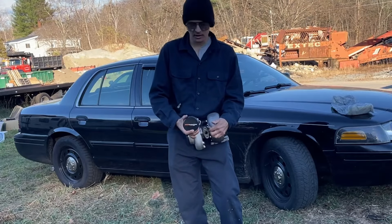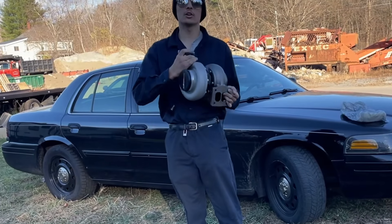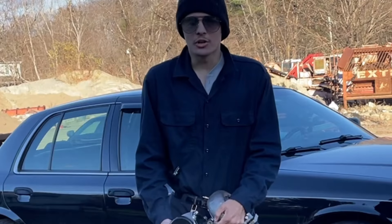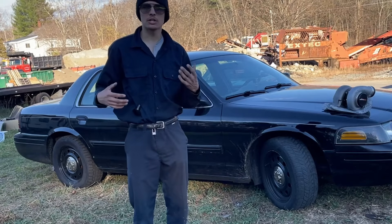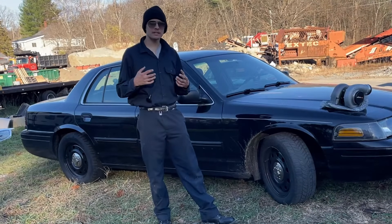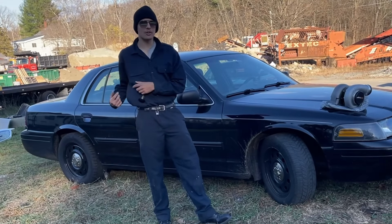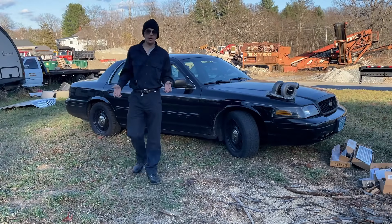Another thing you'll need to do is create an oil setup. With this turbo it is an oiled setup, meaning you have a pressure line coming in one side and a return line going out the other side. Without oil, your turbocharger will without a doubt freeze up very fast — and that's not good. There are two different types of oil setups: one that is based off the engine oil pumping through your car — in which case I'd probably use an oil filter relocation kit and put the turbo somewhere in between the engine oil and the filter — and the second option is to create an independent oil loop. Because I'm going to be rear-mounting this turbo, the independent loop will be the best option for me so I won't need to plumb lines all the way from the back of the car to the front. I will need my own reservoir and a sump pump, but all in all it'll turn out better for me.